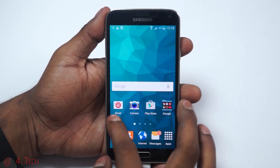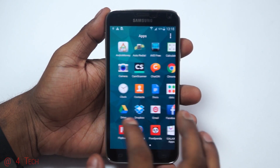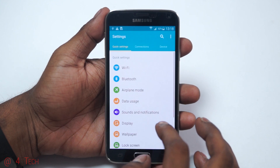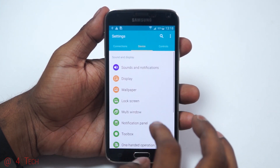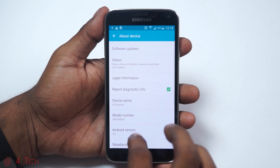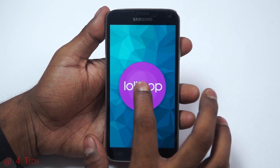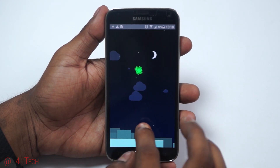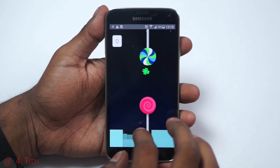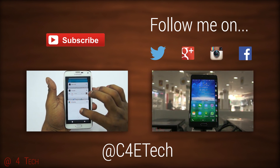All the apps and data have still been preserved. There are a few extra new ones but those are region-specific, so don't worry about that. Going into Settings, General, About Device — and there you go, Lollipop. If your S5 did not boot up, pull the battery out, pop it back, and hold volume up, power, and home — release the keys once you see Galaxy S5 displayed on screen. This takes you into recovery mode. From recovery, select factory wipe, then reboot, and your phone should boot back up.